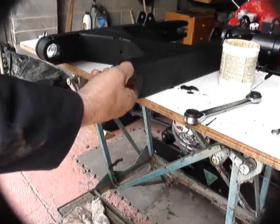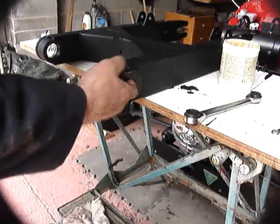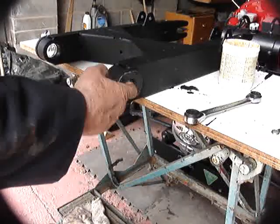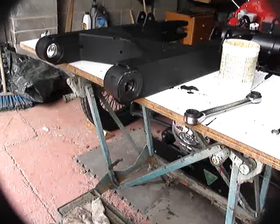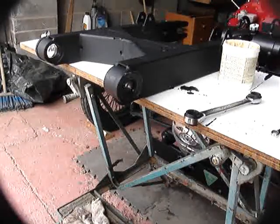Not forgetting, of course, just a little bit of grease on the inside of that seal, just to make sure it doesn't catch up and get damaged when we put the shaft back into it. Now I'm going to do the other side.